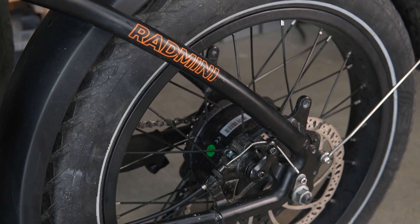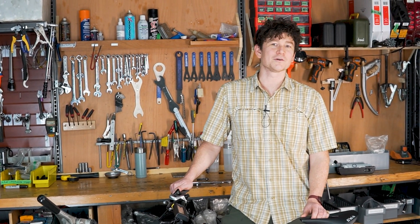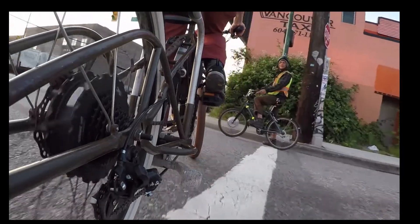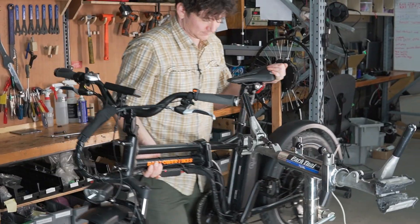In the third part of our factory upgrade series, we're going to be converting this geared hub motor that freewheels into a geared motor that does regen. So just like our GMAC hub motors, a geared motor with a locked clutch is capable of doing very powerful regenerative braking, allowing you to come to a stop without engaging your mechanical brakes, greatly extending the longevity of your brake pads and adding superbly controllable braking in all weather conditions.